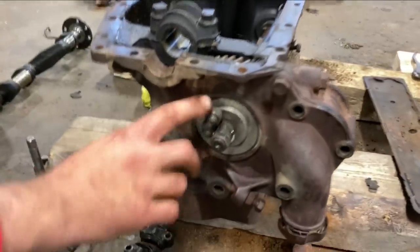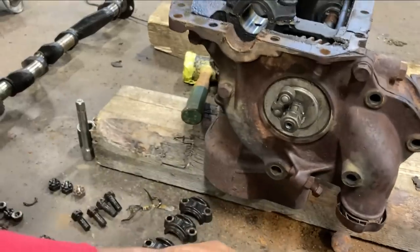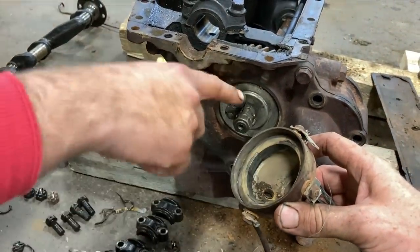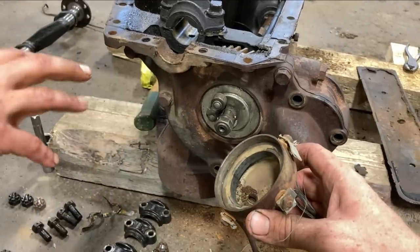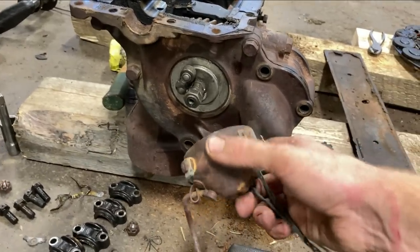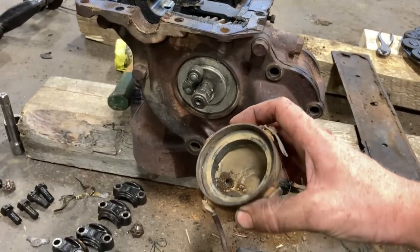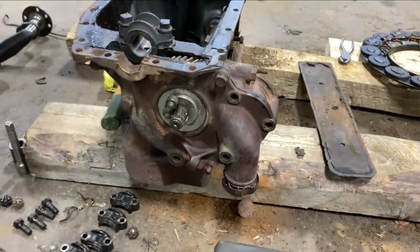This is the ignition. It's a roller that goes around and makes contact here, which grounds the circuit and buzzes the coil. It's not like a distributor in the modern sense — it's more or less just a contactor. They call it a commutator. It's got an insulator in there and four studs. Once it hits ground, away you go. Let me tell you, they give out a heck of a shock.